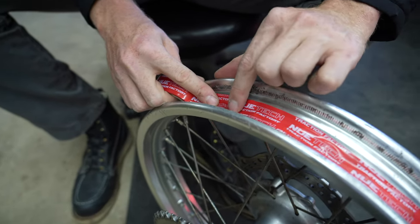One thing I forgot to mention: before you apply the rim tape, you need to drill out the low pressure chamber — which is also the rim lock — to a 7/16 equivalent. Mine was already that size so I did not have to drill. Our valve stem is on the opposite side; per the tubeless instructions they want it between spokes four and five away. I don't want to drill an unnecessary hole in the wheel if we don't have to, so we're going to run it like this.